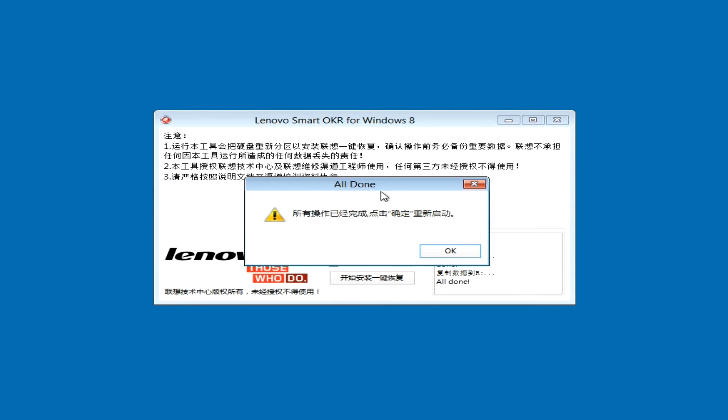All done. You can see this dialog box — it means the installation of the One Key Recovery Engineering DVD is successful. Now you need to boot into your system and change the boot menu from legacy mode to UEFI mode, because once One Key Recovery has been installed, your motherboard will only support UEFI booting for Windows. Then put your second USB drive — the Windows 10 installation disk created with Rufus — into the system and boot from it.